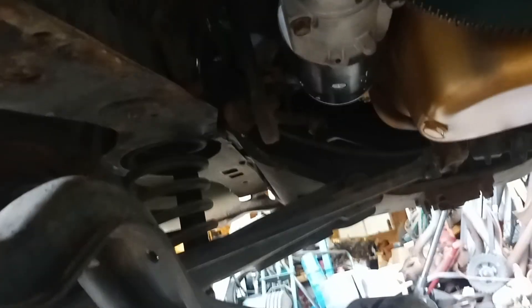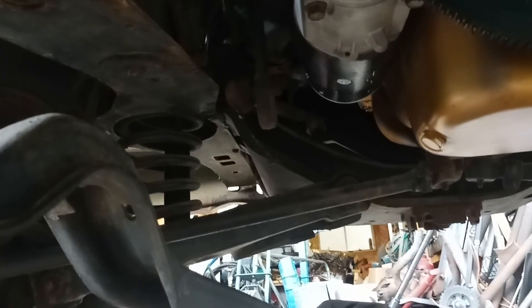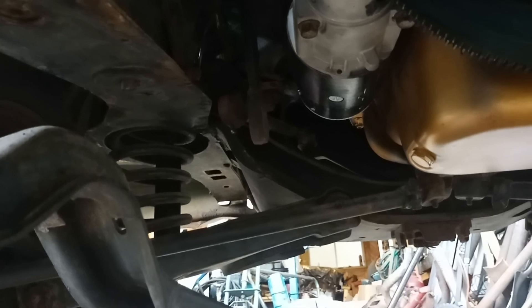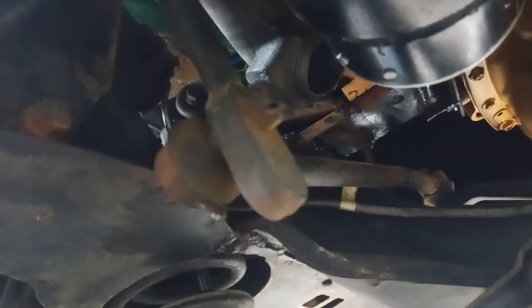One thing I wish I would have done is I wish I would have chased the threads for the donut bolts with a tap, because it would have taken me about two seconds to do it out of the car. Now I've got to sit there with a wrench and turn it little by little. I usually always use stainless hardware on my donuts and cover them when I see it's real good. You can see how the steering moves up and how tight things get as it turns — so this side is going to be a son of a bitch. This side should be a piece of piss, but we'll see what happens here with the weather. I'll start chasing the threads and we'll go from there.